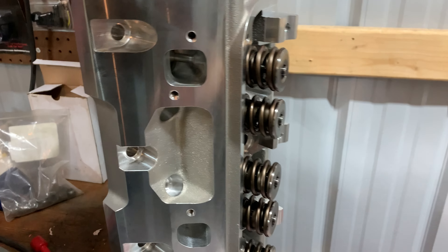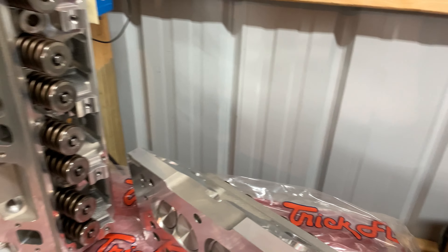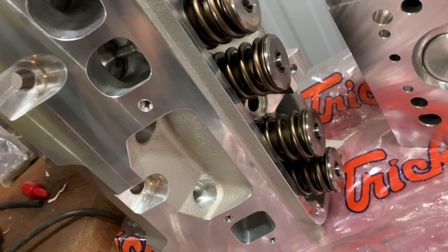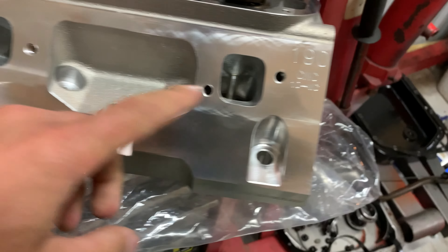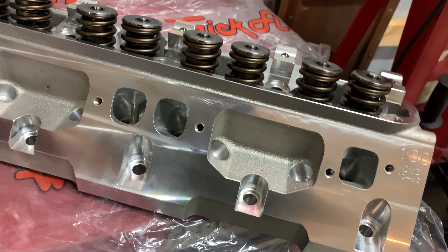Unless you've been living under a rock, you've probably seen these small block Mopar heads that Trick Flow makes. They're a pretty nice head. It was kind of down to the Edelbrock Magnum head, which I really like — they have a nice chamber and a good port — but I would have had to buy Magnum rocker gear and switch all that over, and I can use the rocker arms I have. The exhaust port on these looks a little different than your standard LA small block exhaust port. They actually made them a little smaller, but I think that bottom part is kind of useless anyway. Most of the flow is up towards the middle on the roof of the port, so I think that was just wasted area.